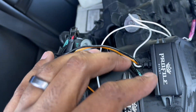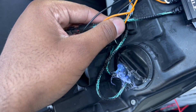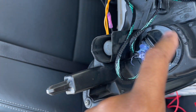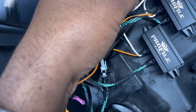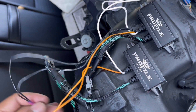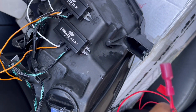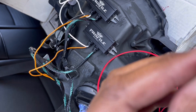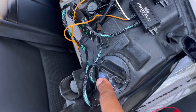There are two drivers: one for the crescents and one for the eyebrows. I've plugged those in already and drilled a hole through the headlight cover so everything can be sealed up. All the white wires on the drivers go together, and then that connects to the power wire. All the black wires go together. All the orange wires go together, and they connect to this plug connector, which hooks up to your turn signals.